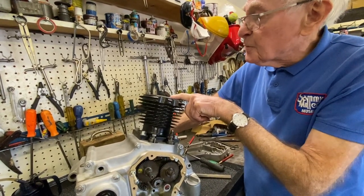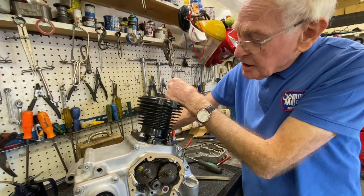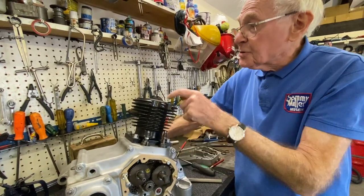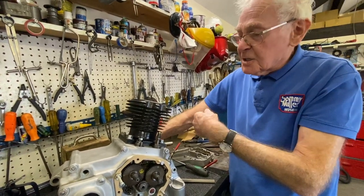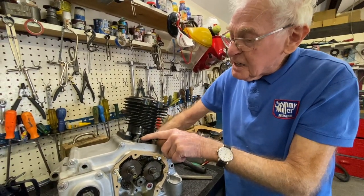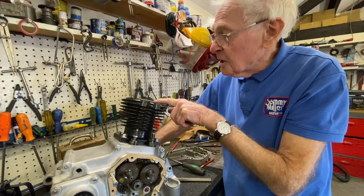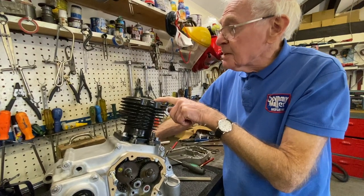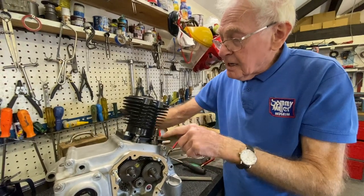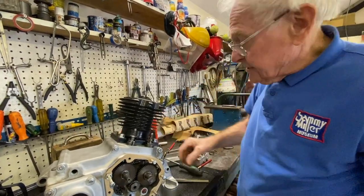So then you're coming up on compression, you're having your ignition explosion go down, and then this is the exhaust valve, which is coming up, pushing all your burnt gases out the exhaust, right? And it's now top dead center, so this is starting to open here to let your new gas in. Okay, so you're going down, filling up the chamber with gas, compression, ignition, bang, piston go down, giving you that power, exhaust, piston coming up to push all the fuel out, getting ready for the new charge, easy peasy.